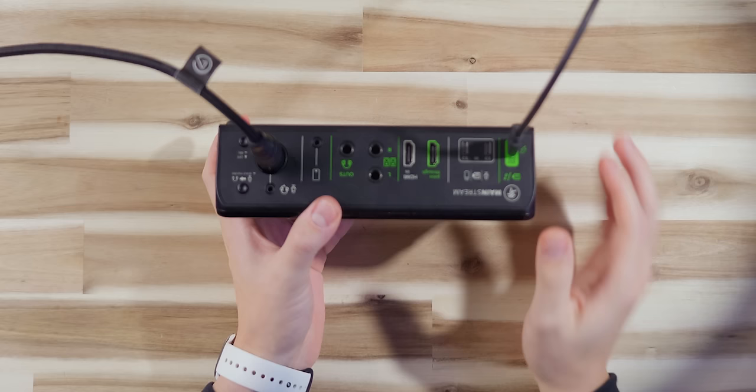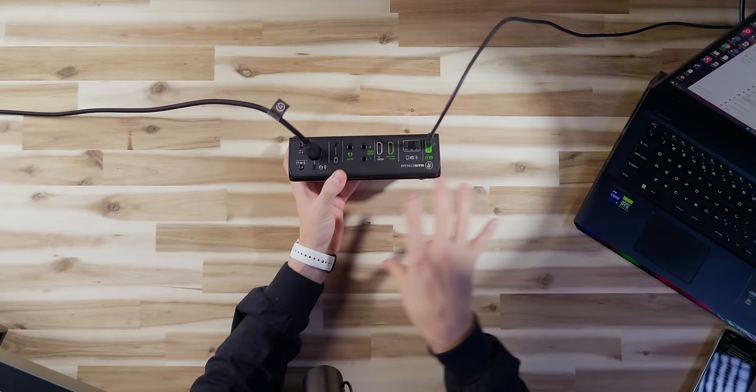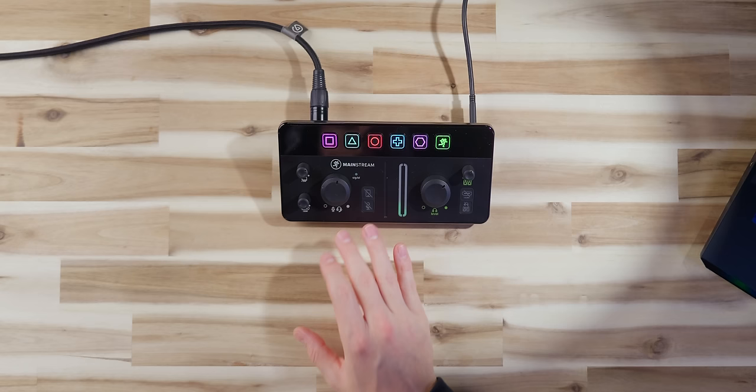Then you get your HDMI in and out as well as three USB ports — and there's a lot different here from the Streamer X. You've got so much more I/O, so much more control, and it's still $100 cheaper. But there are a couple of reasons for that. First off, the microphone preamp in here is not the same preamp you see in the giant DLZ devices — it doesn't have 80 dB of gain, it only has 60 dB. That might be the biggest deal breaker: 60 dB of gain is about the minimum you'd need to power an SM7B. I'm using the SM7DB which has its own built-in preamp adding 28 extra dB, so I'm only pulling about 30 dB from this device.